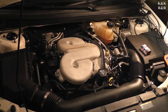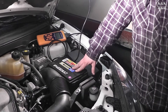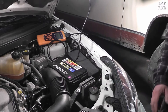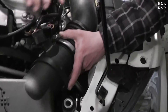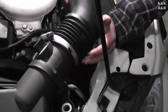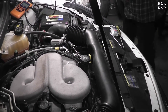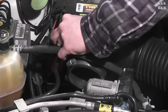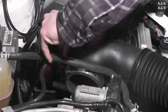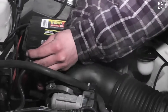This one's interesting but we're going to start by getting the battery out of the way. Now that the battery is disconnected and we don't have power to any electrical circuits, we can remove the air hose. You're going to want to undo your MAF airflow sensor, and the whole air box is going to come out. Quick plastic disconnect for the PCV system — you just pop this little plastic connector and pop it over real quick.